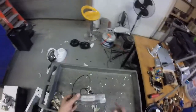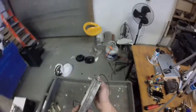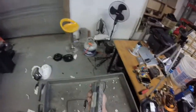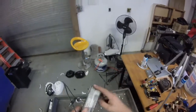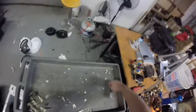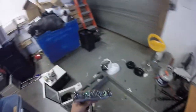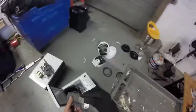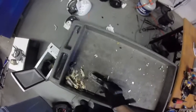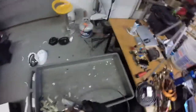One other thing I wanted to show you - when you're working on a cart like this and you've got a lot of mixture of plastic and steel and other things, if you want to quickly grab all the steel, just get yourself one of these cheap retrieving magnets. I got this at Harbor Freight, I think it was like $12. What I didn't like about it is it's hollow in the middle, so I put some heavy-duty tape around the whole thing. When you just use the retrieving magnet you can pick everything up usually in one shot. If you want to just clean up your steel and stuff, just slide it right off. Now I'm comfortable that there's really nothing - no other metal on here.